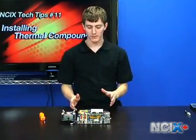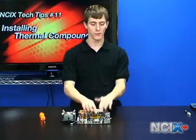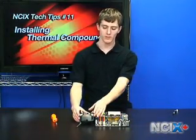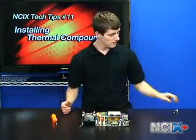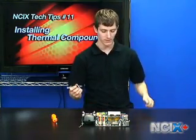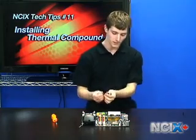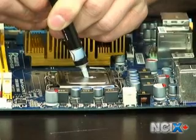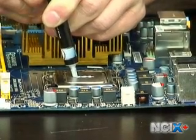As you can see, as with the AMD CPU and heat sink, there is a lot of residue left over, so we'll clean them in much the same way as we did the AMD one. Now I've removed it — same procedure — so you can see that they are clean. We're going to talk about the line method of application this time, squeezing a line along the IHS, or the heat spreader, of the CPU just like this.